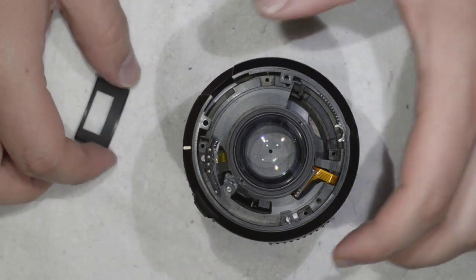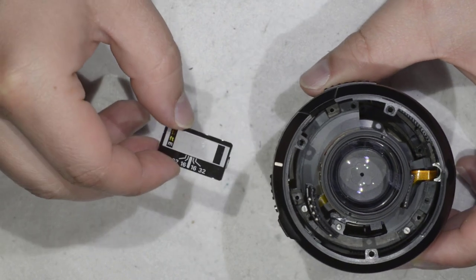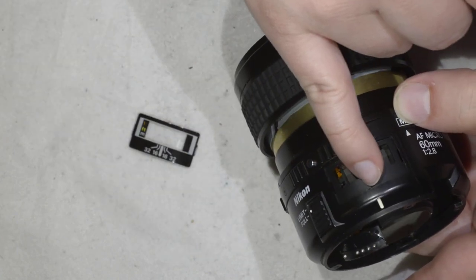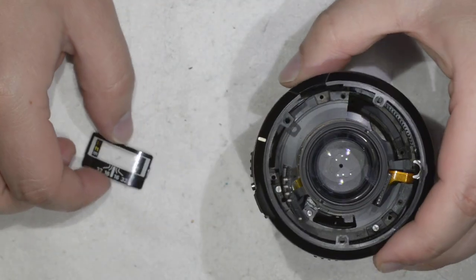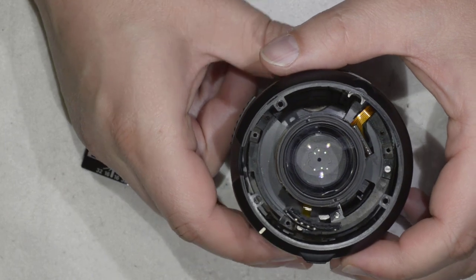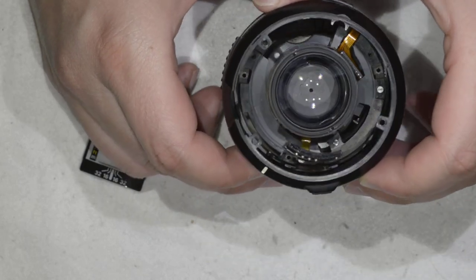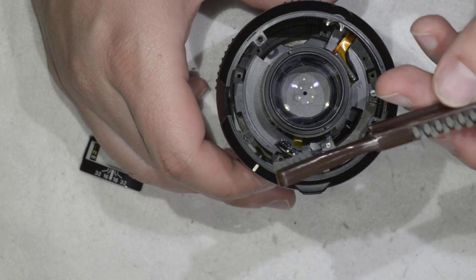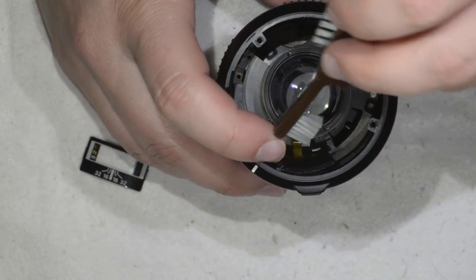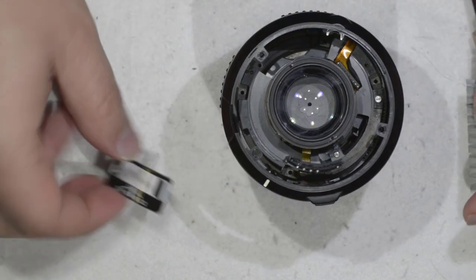After a bit of struggling I did what I wanted to do - this window is popping out. You can remove it from the front but then you're going to mark the lens, which is not the goal. The method I prefer is to wiggle this thing until I'm able to take it out enough that I have accessibility to the window. What I did is take this brush - I use the brush because it's plastic so it's soft and it won't scratch the window - and just pushed a bit until the window popped out.